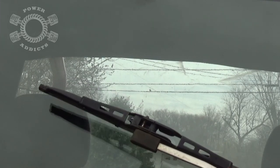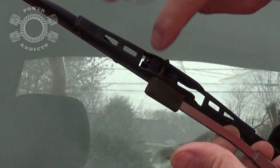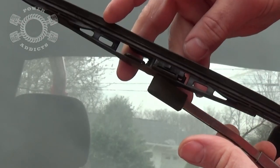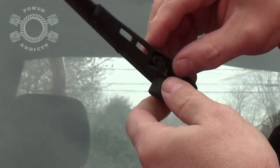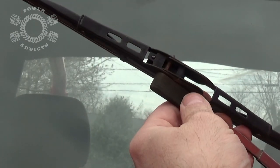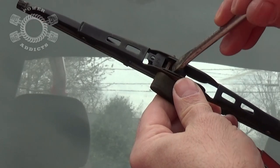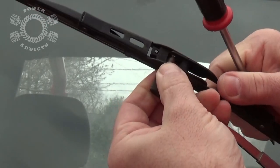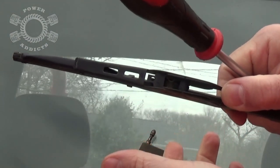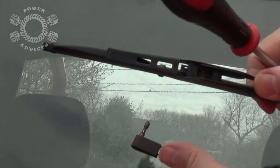The first thing you want to do is take your arm and pick it up off the windshield so you can manipulate it around. You turn it, you pull this tab towards you, and most of the time they'll come loose. But if it doesn't, you can get your screwdriver, get right down to the side of it — a small screwdriver — and push down on that tab and they'll pop right loose. And don't drop that arm against your windshield, that's a bad thing.